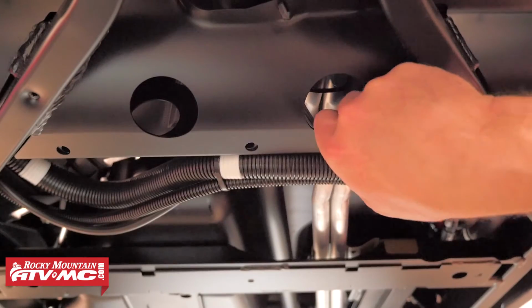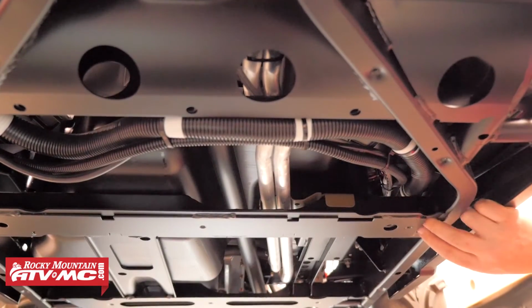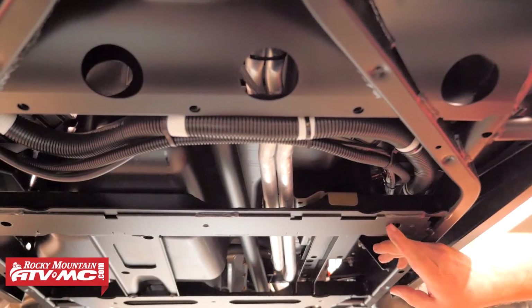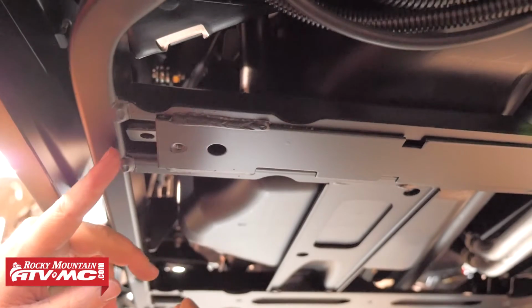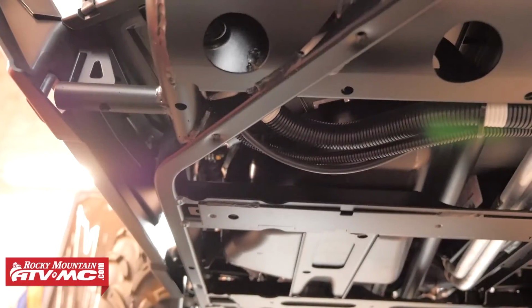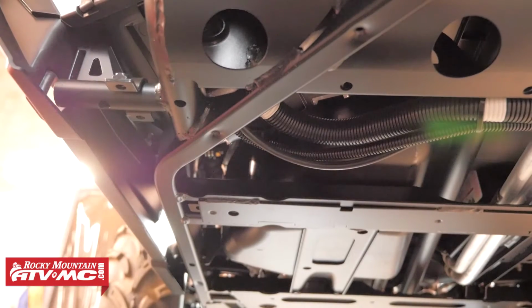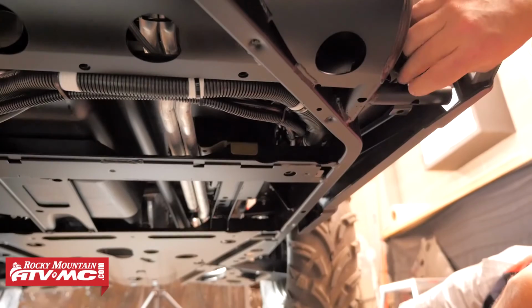After we have those 3 clamps into place, we're going to move back and position the 2 remaining flat clamps through the rectangle openings in the frame and over the hole on each side. Again, we're lining up the threaded hole on each clamp with the hole in the frame the best we can. The 2 provided rounded clamps are going to sit over the frame bar sticking out on each side like you see in the video. And with all the clamps now in position, we're ready to attach the plow mount.